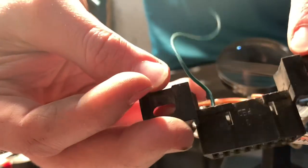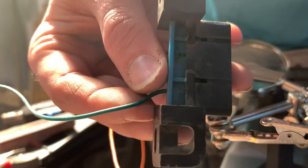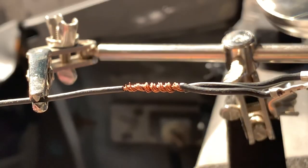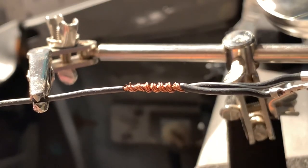On the wiring diagram for OBD2, you need to make a jumper. Here's the OBD2 port I got off of the actual Tahoe — it has these blue clips that slide down in and click in. To get those out you pry up on the black and pull the blue out; don't try to smash the little pins. Once you slide that out, there's a little tab on the inside — you pry toward the center and slide out the connections.